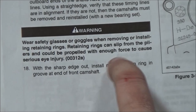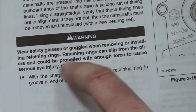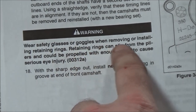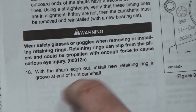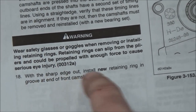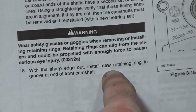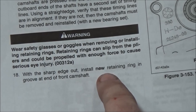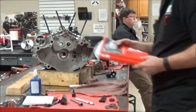When you look at the directions, you look at your checklist, people go 'okay I did this, I did this, I did that' and then they miss this stuff. Notice that the warning is before the procedure — safety glasses here for removing or installing, you don't want it to fly off and create an eye injury. Then look at this one: 'With the sharp edge out, install a new retaining ring in the groove at the front of the camshaft.' Notice how they bolded the word 'new' — they're trying to catch our attention, saying if you haven't got this figured out yet, we don't reuse these. That's where it talks about the sharp edge, and that is how you install those.